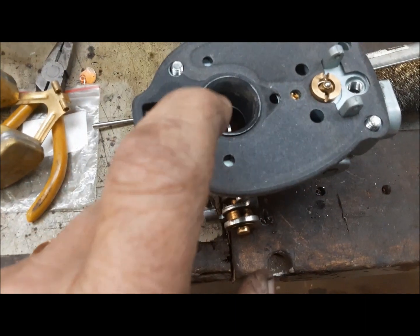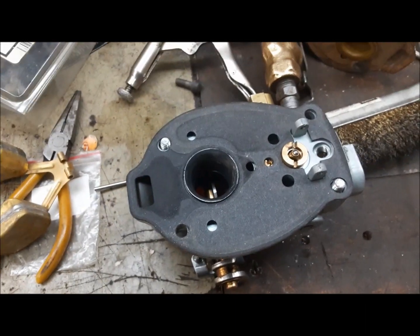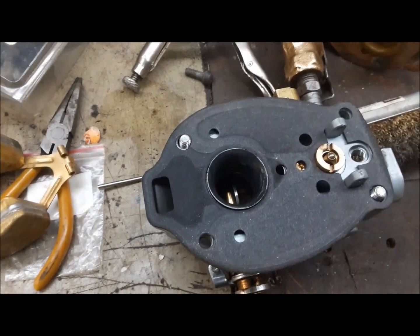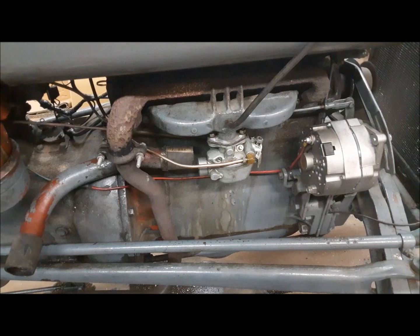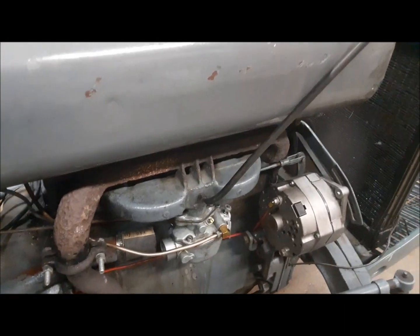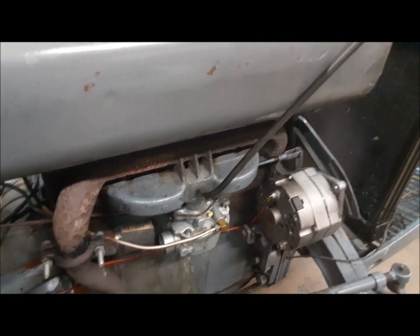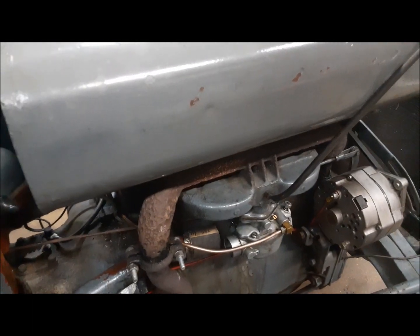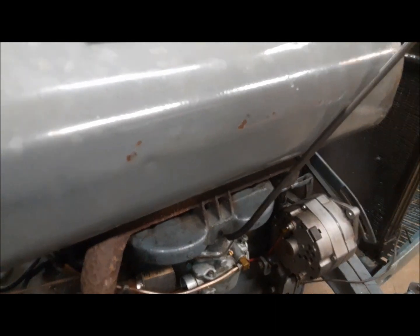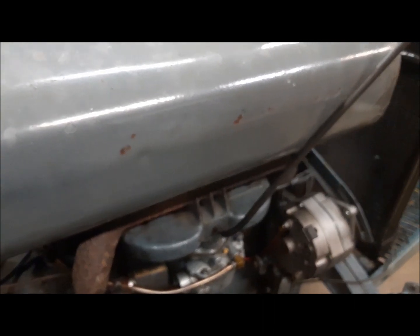So we're going to put the new carburetor all back together and try it one more time. Failing that, we're just going to stick with what was working over there before, the old top on the new bottom. So you can see I put the imported carburetor back together. I raised the float. It's all good. And still, when you try to pick up the mains, it starts surging.